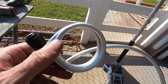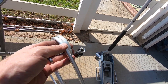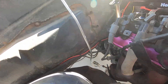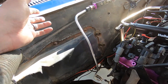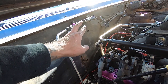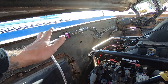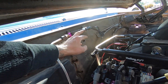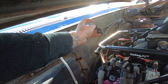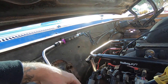There you go — that's how you do a curlicue. Not too much pressure so you don't flatten it out. Let me finish making the shape we want and we'll plumb it in. So exhaust pressure comes from the weld fitting, up the tube into the vacuum manifold block, and this should monitor the change in PSI. Now we have to wire it — I need to find my 5-volt reference, signal wire, and ground.